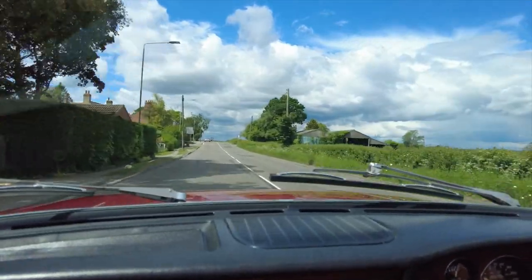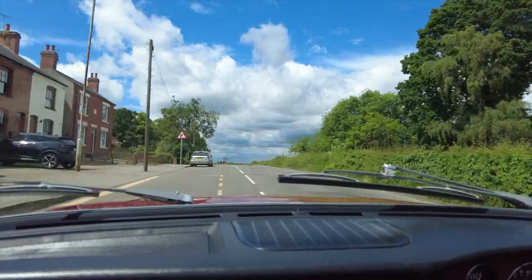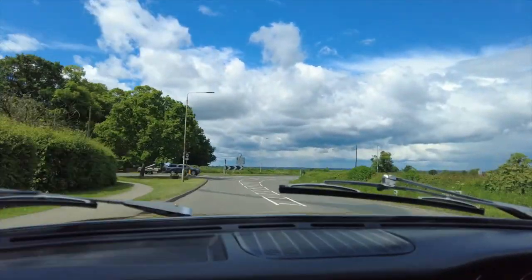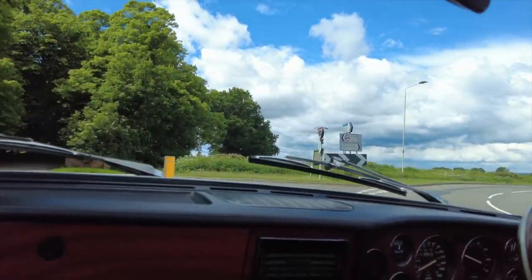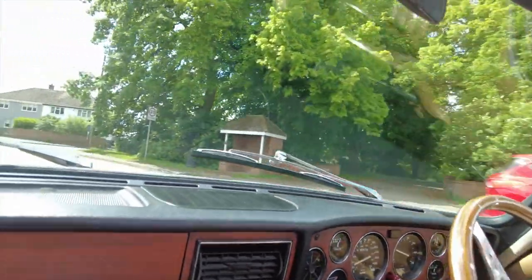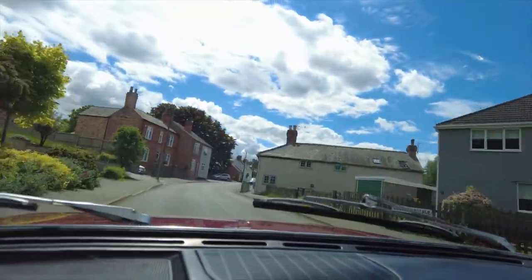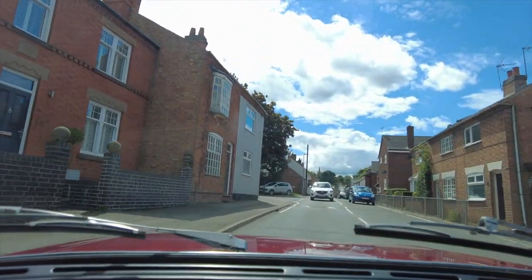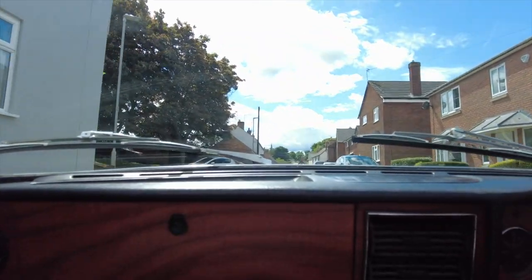Superbly. I mean, it's my car, I know that, but it revs happily, went straight up to the speed limit there, no problems whatsoever. The carbs have been rebuilt about a couple of thousand miles ago. They've been rebuilt twice, but I did them again because I bought a really big ultrasonic bath on eBay and I needed something to test it with, so I took them all apart yet again. Awesome. So they've had all new Stromberg bits in them.